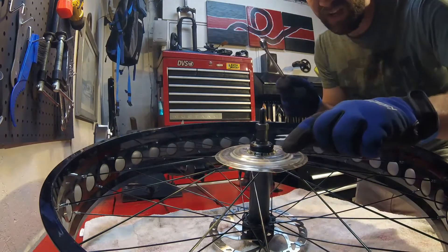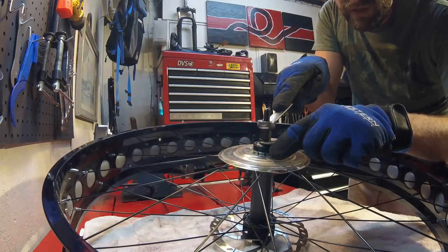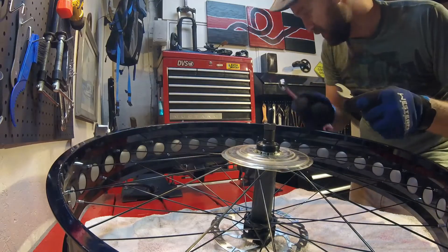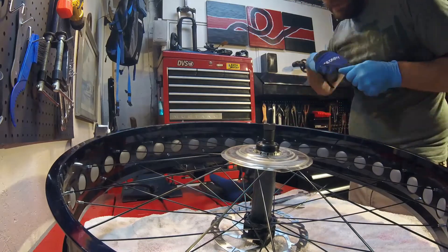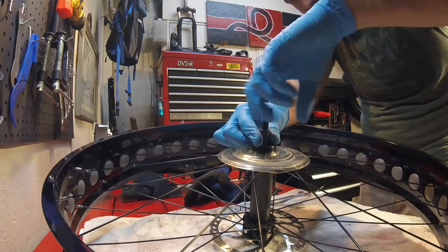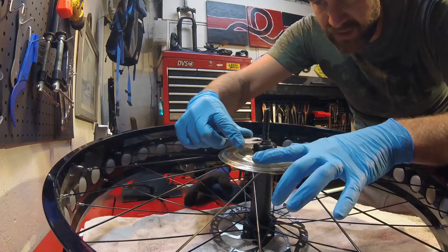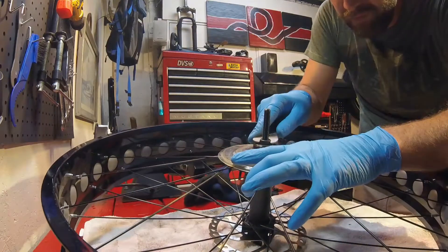These just kind of take the edge off. And what you're going to do is you're going to grab this flat right here just above the hub and then you're going to come up here — and sometimes these can really fight. There we go. Sometimes those can be really tight. And if that's the case, you can do that same thing with the cheater bar and try to work it around with extra leverage. Now that we've got this loose, we're going to completely take this nut off. And this is just a spacer that's going to come off too. And then what we need to do is remove this — and this is where you first use that cone wrench. That is actually going to come out from the center of the hub.